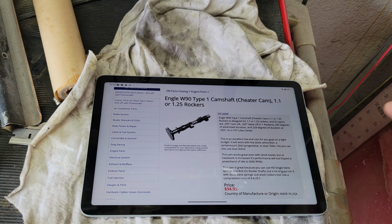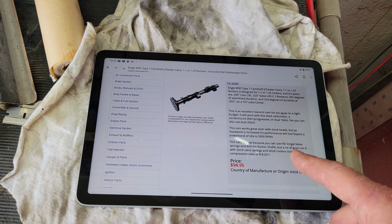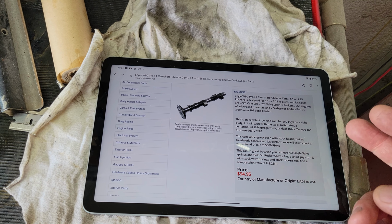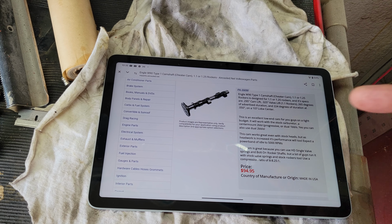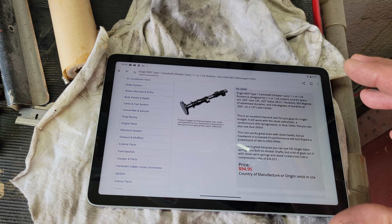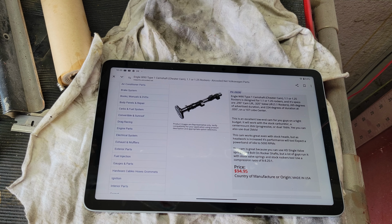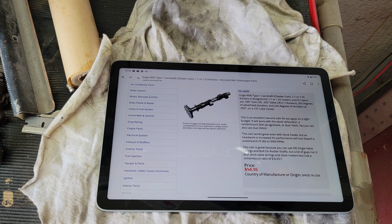And you'll find that all the ones, if you read all the stuff on them, they'll say stuff like 5,000 RPMs. That's a basic thing. If you start porting the heads and you go with bigger valves, and you're using a smaller engine with big valves, then you're going to want to go smaller on your cam, because you're going to have too much air and fuel in there, or you're going to have to bump the compression way up to like near 9-to-1, and then heat is going to be an issue. Man, if you have a big enough cam, you can run 9-to-1 on the street, as long as you're running premium fuel, it'll work.